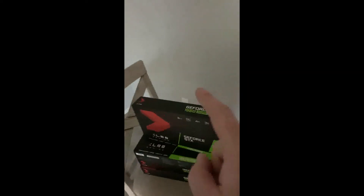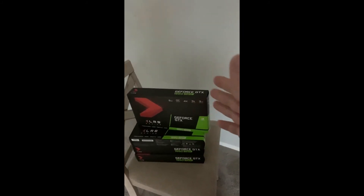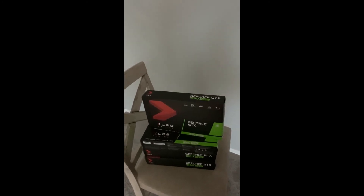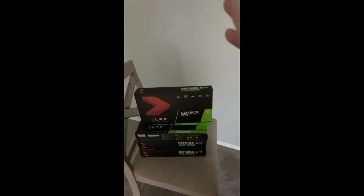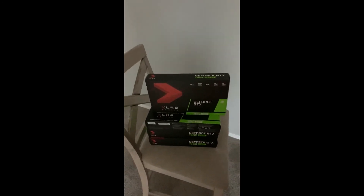This clock lock actually turns down power consumption while keeping the same hash rate. I think they got the 3070s down to around 110 to 115 watts, which isn't huge but it adds up. I watched a video from Red Panda Mining who had a 1660 Ti / 1660 Super 12-GPU rig and he shaved off around 350 watts total by doing this new core clock lock.